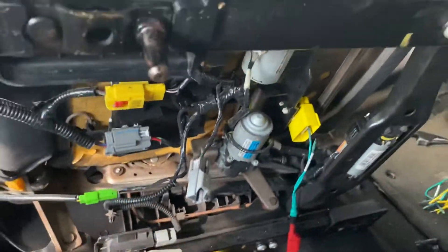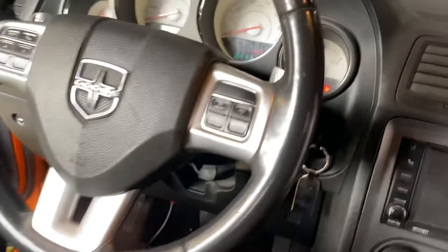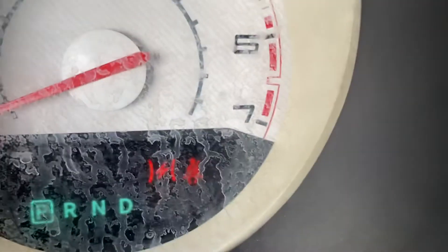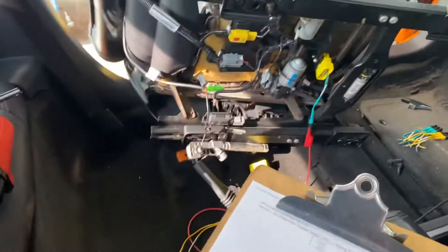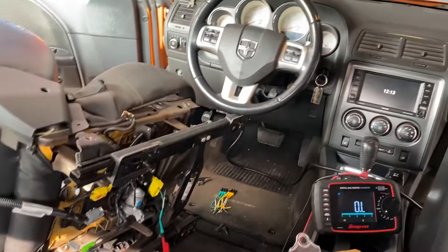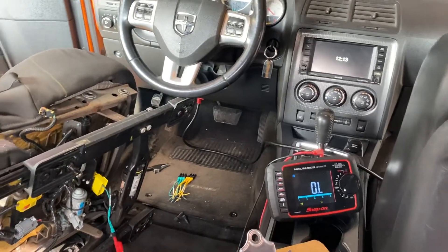The other thing you need to know is: if you have the SRS light on the dashboard blinking, and also the seat belt light stays on even when the seat belt is buckled in the driver's seat, then you may have this kind of problem.